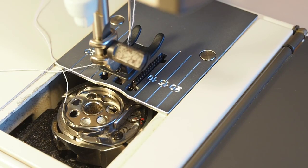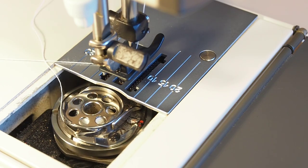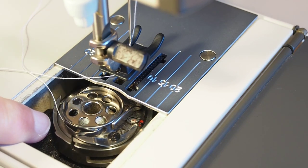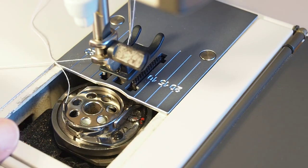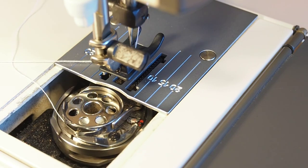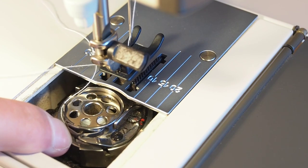So when diagnosing this problem, just looking from the rear quarter of the machine, you'll see the needle here. I'm turning the hand wheel in operating direction. So you'll see the needle moving, and the hook is also moving here. And the reason that the hook is still moving is because part of the gear is still intact. There's only one portion of the gear that's broken. You could take a look in here and see that the hook's moving, but although it's moving, it's only moving when the gears are meshed, and when it gets to an area where the gear's broken, you will see that the hook momentarily stops